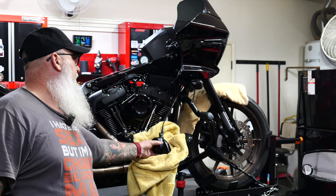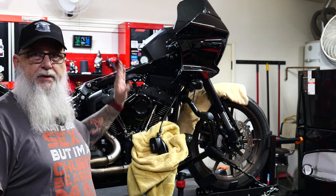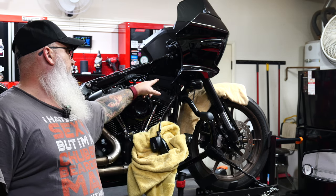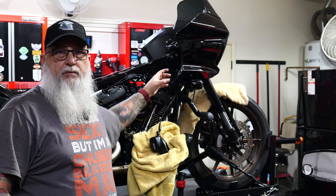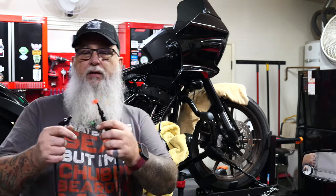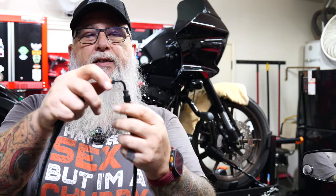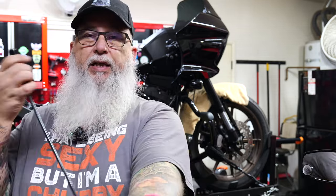Now we've got those out. Now we've got to get the stock bushings out — you can leave them in there and use them, but I wouldn't. I'm going to take a socket and pop it down. The next thing is to change out this brake cable. I left the whole assembly hanging down because I didn't want to mess with it until I got the bike up. You've got a 14-millimeter bolt here that comes off the master cylinder, and then a 10-millimeter bolt up front underneath the headlight area on the forks at the bottom of the triple tree that connects to the brake block.